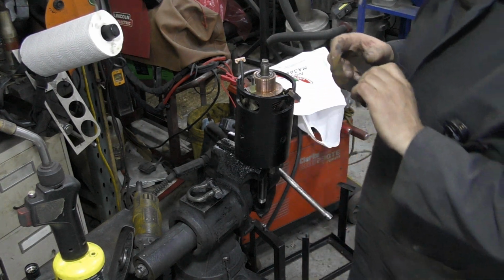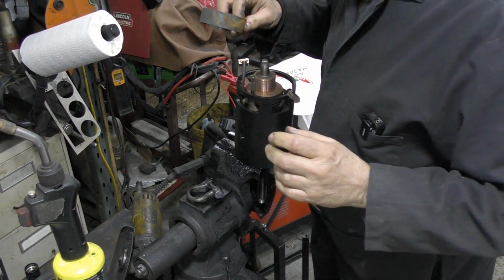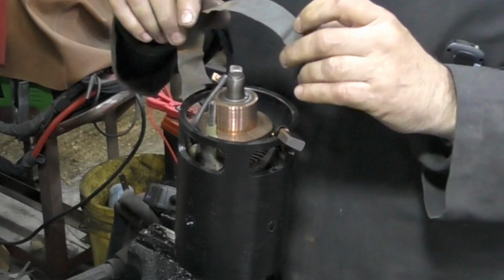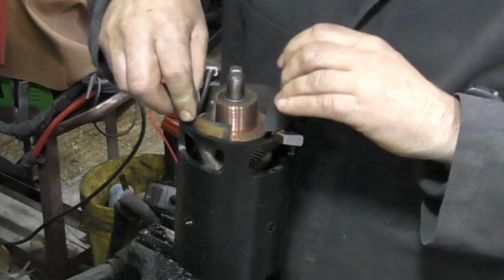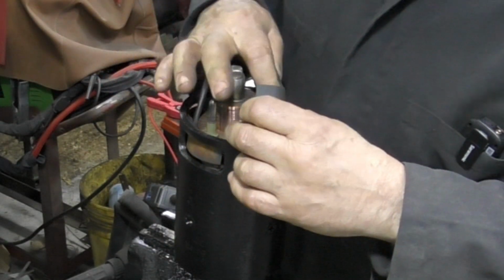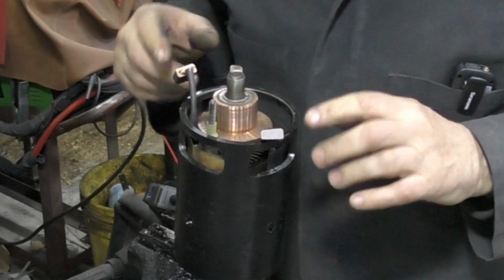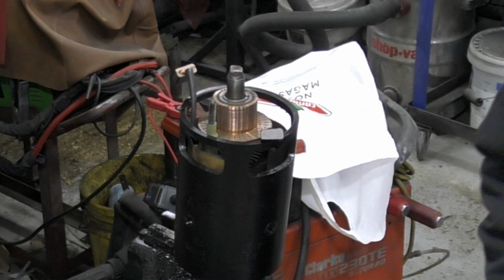Now I'm going to put the paper in. Yeah, we want to miss, oh, there goes my spacer. So we want to miss those electrical contacts down there. So that wants to go down into there. There's two electrical contacts where they've soldered on, so that piece of paper becomes the insulation. Now this is the bit that's not sort of very exciting.